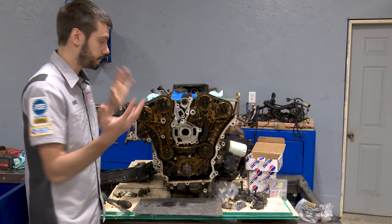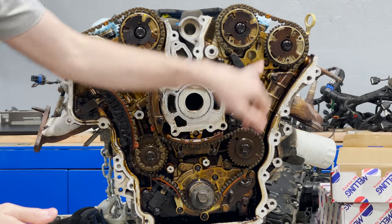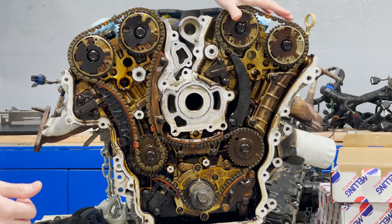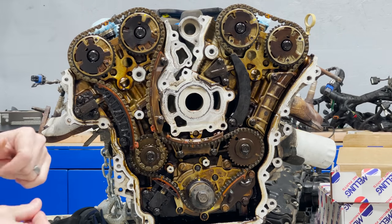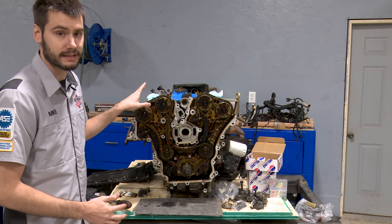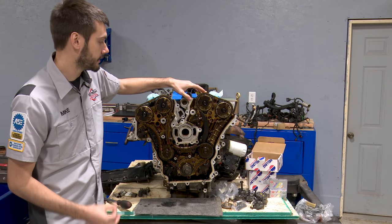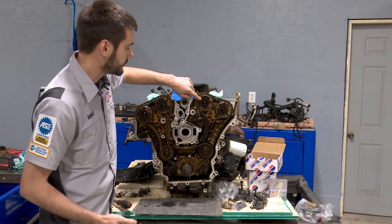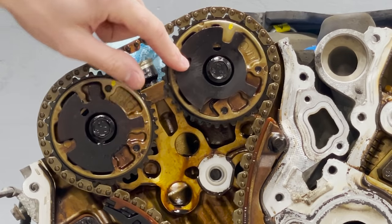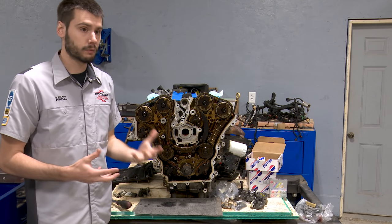So we got to this point, pulled the engine down and apart. This is a uniquely timed engine — we're working with three different independent timing chains: the right side secondary chain, the left side secondary chain, and the primary chain down here. This is the right side even though it looks like it's on the left of the engine. You can tell by looking at the face of the intake cam phaser — the left side is marked with a small L and the right side with an R.